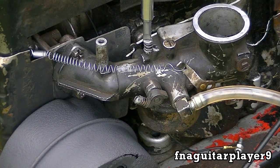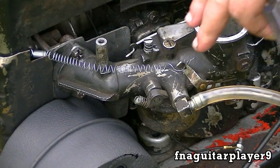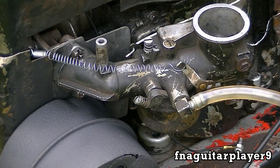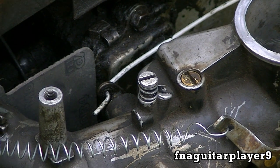Now if you get a motor that you're not sure if it's adjusted right, screw it all the way in until it gets snug — don't force it — and back it out one and a half turns. That's half a turn, one turn, one and a half turns. The same goes for the bottom screw too. That gets you in the ballpark and you can go from there adjusting. When you screw it in — either the top screw for the low side or the bottom screw for the high side — it leans it out. And to get it to run richer, you screw it out. Take about an eighth to a quarter turn each time you adjust it and see how it does.